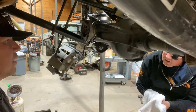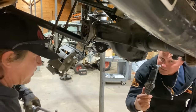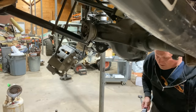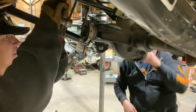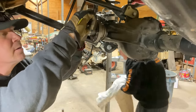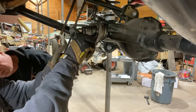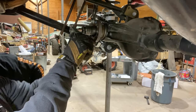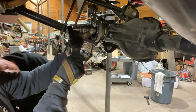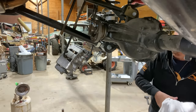We are gonna now very carefully and incrementally tighten it, and then we're gonna grab our inch pound torque wrench and we'll check. Right now we've got nothing, so we still have to. It probably has like 4 inch pounds. Really close. Well, we're gonna get it on this next one, or two. So it's gotta go all the way up to there. Yeah, exactly. And right now we're at hardly anything, 3 or 4. But it's not gonna take very much to get the rest of the way.